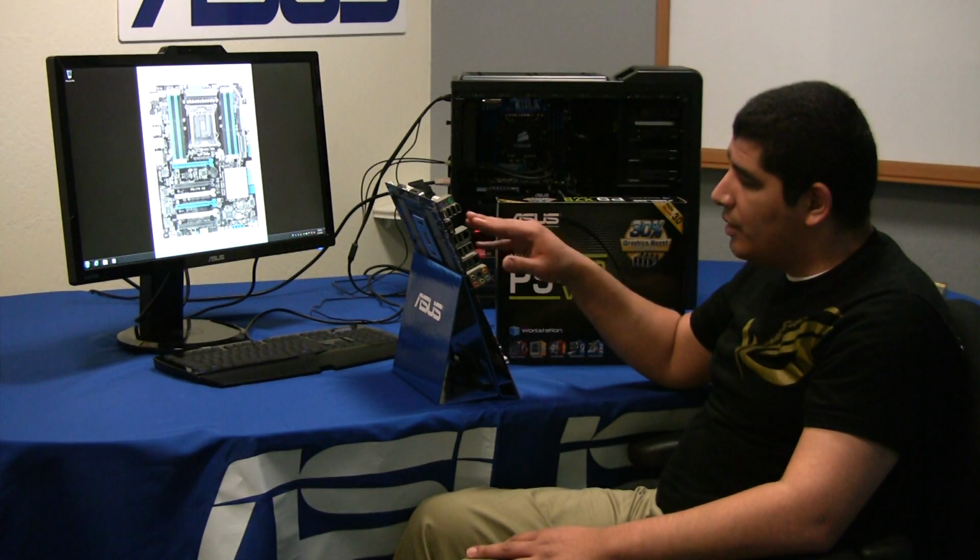Maybe you're running gigabit networking at home, or utilizing this in a server workstation environment, running out to a high performance router configuration, maybe a Windows Home Server box, or a high-speed router where you're doing online storage, different variables like that. It gives you a lot of flexibility. With the Intel class of adapters, you're going over to a higher performing NIC, generally lower CPU utilization, overall better performance, better compatibility, and better interoperability with different types of applications or OSs. And one of the really cool options is definitely some of the advanced options that you get in Intel's advanced network management options, which are present within their drivers.